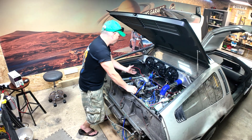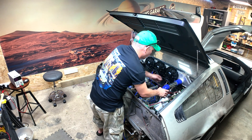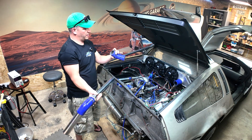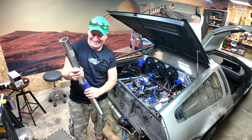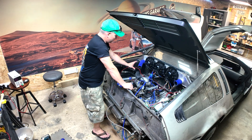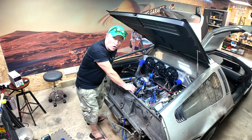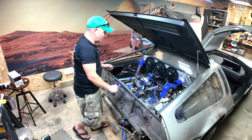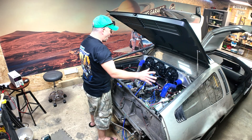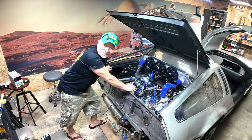From there I think all we're going to need are 135-degree elbows. I've got one on this end of the tube already. I also want to replace this stainless steel tube because it weighs an absolute ton — it's never going to rot but it's a bit heavy duty for what we need. That's the wrong pipe to connect them up but it looks like it's going to do the trick, so that's one side done. I want to get all the hoses the same colour eventually but at the moment I'm working with what I've got in my scrap box. That is basically the turbo setup: straight off the turbo, down into the inlet side of the intercooler, air passes through, the big fans pull it through, and we just need the tubes coming in from the scoops. I think that looks really, really cool.